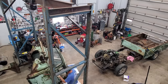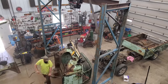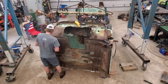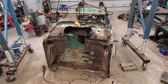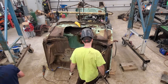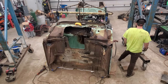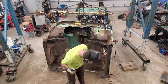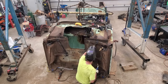We're going to be tipping over the cab to make it much easier to weld this new steel in. Laying underneath the box, welding in, cutting, torching — that really sucked, so we're going to tip it over, make it easier on myself. A few of my buddies here are helping me do the dirty work of cleaning it up for welding, so I appreciate them. Then cut out some gussets and some brackets and started adding steel back in, just to reinforce those cab mounts since we got some natural weight reduction, like I mentioned.